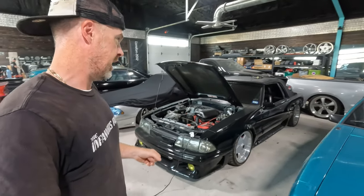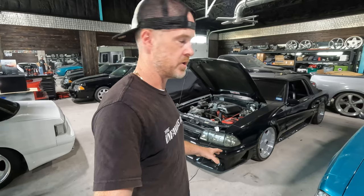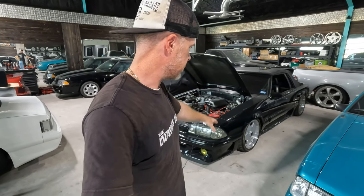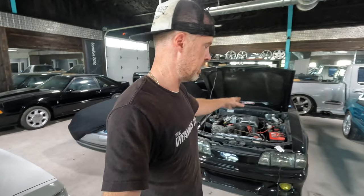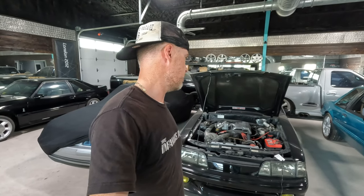So I'm gonna have to get the car started up. I've got the battery tender on it, so there should be enough juice in there since it's been sitting for a while. Drive it up on some 2x4s, get the jack under it, and hopefully get access to the clutch cable down in the linkage area off the bell housing, get at the clutch fork, and be able to swap everything out, and hopefully we'll have a better clutch cable.